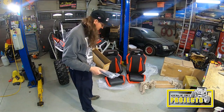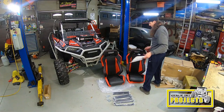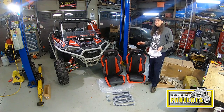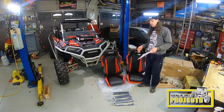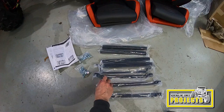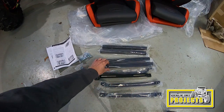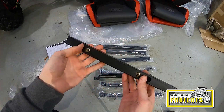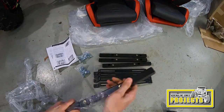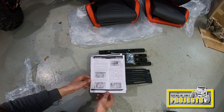The seat brackets come with some pretty detailed instructions and hardware. Now remember, the seat is definitely a safety device in your vehicle — it's part of the roll cage, the rollover protection system, and it's part of the restraint system. All these things work together, so if you install any of them incorrectly, well, let's not go there. We've got four brackets of each type, and there are some square inserts with thread certs along with two hardware packs.